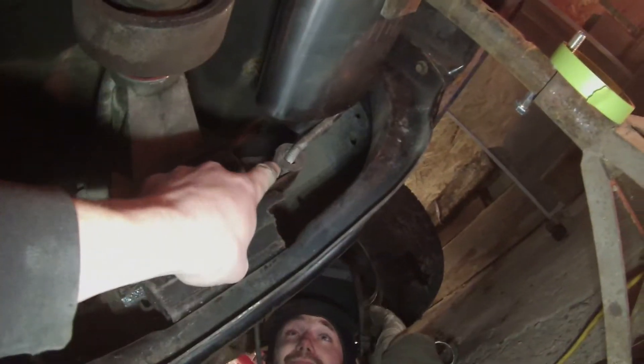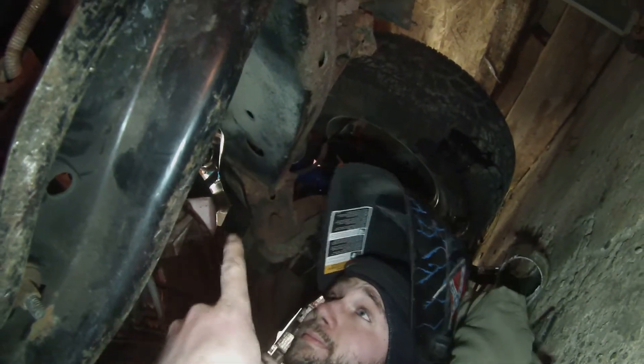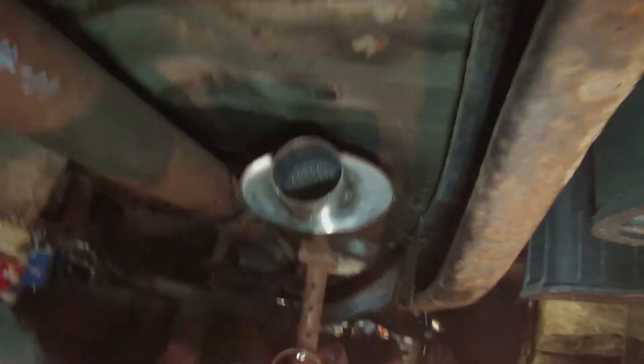Of course I had the camera off when Andrew burned his eyebrow with slag off the welder, so I got him his welding mask so he can see and doesn't burn it again. We've got the muffler here and we're welding the bracket on with threaded rod. We're going to work from the front to the back and the back to the front, using a bunch of pie-cut angles to manipulate it down into position - hopefully without burning an eyebrow again.